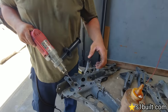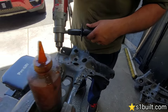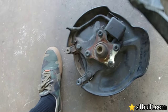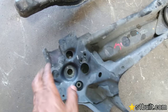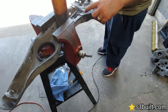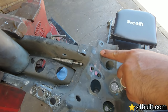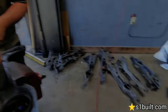You can see KK is drilling away — that's part of the process of making these OEM style arms. You want to use some kind of lube so you don't burn out the bit. These are how the arms come in — you have to source them first, go to the junkyard. They usually come together like this, and you have to remove the bolts and take the disc or drum piece off. Then you drill out the tabs — there are ten spots to drill out.